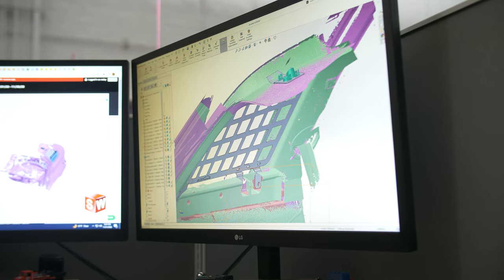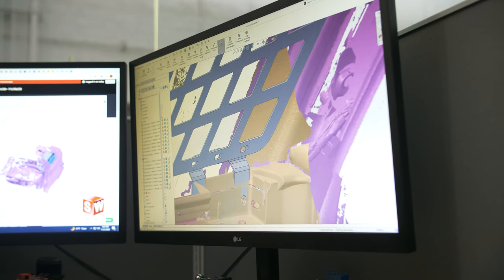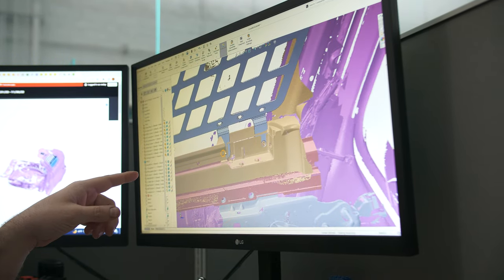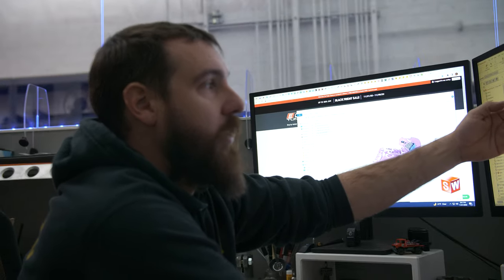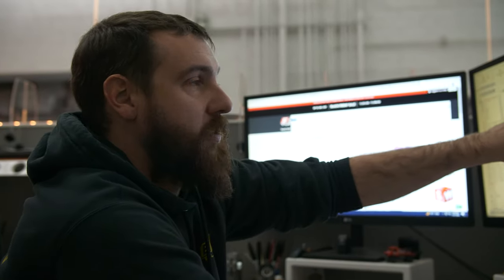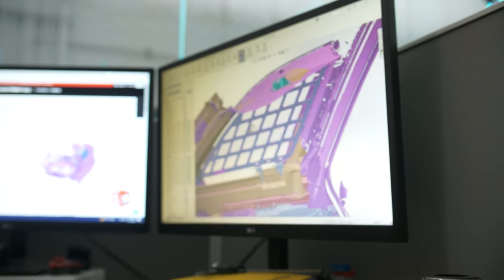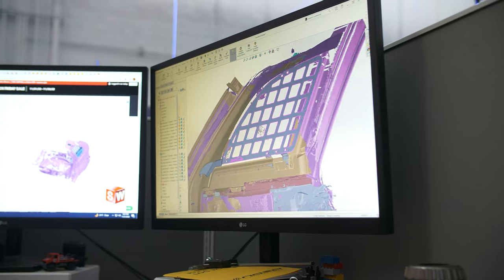And then on top of that, there's the pre-LCI cars, which had this front location over here as a mounting position for that screw, not the rear position. So I made this bracket flippable. You'll take what is the left bracket on an LCI car and it will be the right bracket on a pre-LCI car. So that way, you're just putting them in a different set of those slots and you can just flop them left to right and it's the same assembly. So that way we don't have additional parts, no additional hardware. All that should fit in there nice.